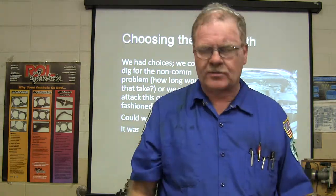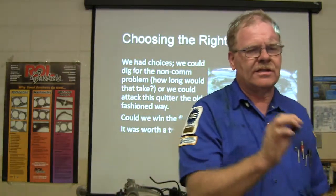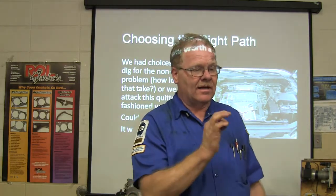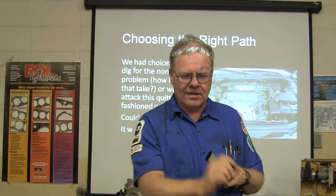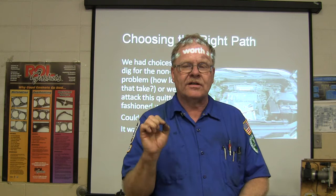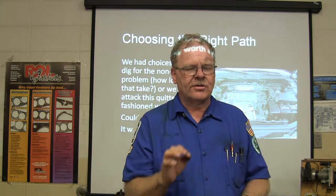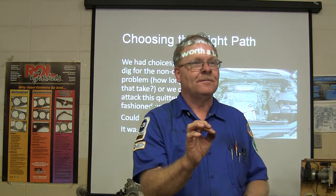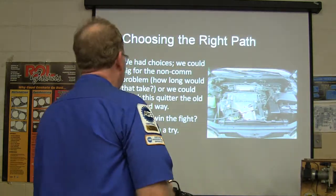They were trying to help us with that, but I threw it over there. And when I got cars in there, I would measure the voltage on every sensor every time. And I got to where I didn't even have to write them down. I knew what they were. I made me a long probe with a little alligator clip on it, some heat shrink on it, and I could go in there and back probe those connectors and read those sensors. After I had read a bunch of them on good cars, as soon as I saw a bad one, I'd say, this is right, that's right. Whoop, that sensor's reading too much. That ain't right. And then I would know to go in there and see if we had a wiring problem or sensor problem, something like that.